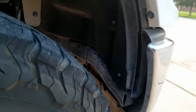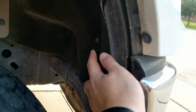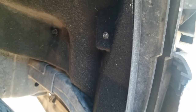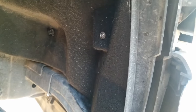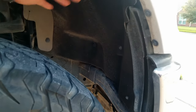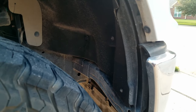The first step of getting to these fog lights — I've got one screw there, one screw there, one screw there, and that plastic pin right there. They look like a 7/32nds-ish. I'll get the ratchet out, pull those back, and that will allow me to take this cover and tuck it back over here so that I have access to the fog lights back there.